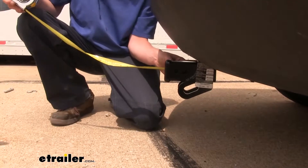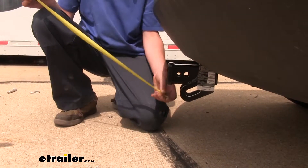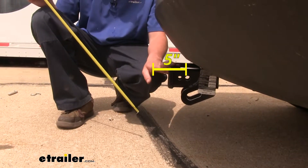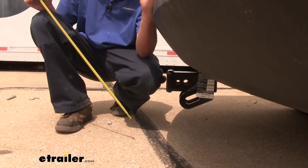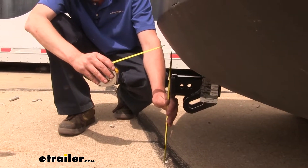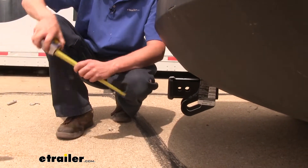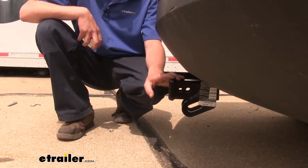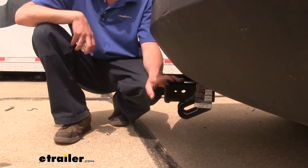I've got some measurements to help you when deciding on accessories. From the center of the hitch pin hole to the edge of the rear bumper, it measures about five inches — important for determining if any folding accessories can be placed in the upright storage position without contacting the bumper. From the ground to the top inside edge of the receiver tube, it measures about 12 inches. This is important when determining if you need a drop, rise, or raised shank on any of your accessories. Since it is kind of low, I would recommend a raised shank.